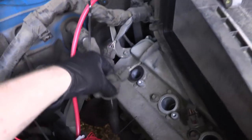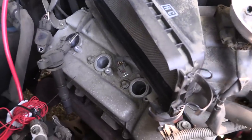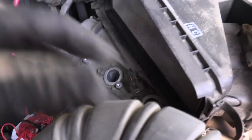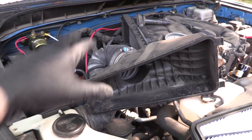We unbolted each one of the coils and popped them out, labeling them so I know which is which — it's my own labeling system. Next, you get your spark plug socket, go down in there, deep dive, pull all the old spark plugs out, throw the new ones in, put the coils right back on top, and you're done over here. Then we'll put our new air filter in, and we'll be done with the whole passenger side.